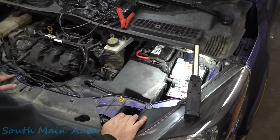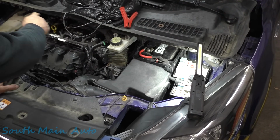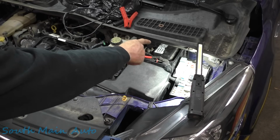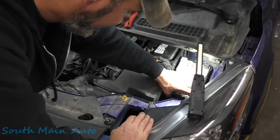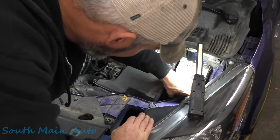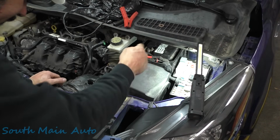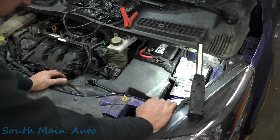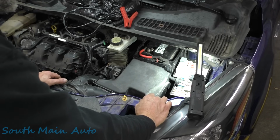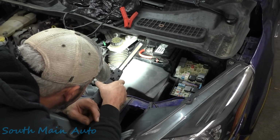So according to the wire diagram, that wire is a 100% straight shot. Runs out of that fuse box, up all the way across the firewall, over to the strut, under the battery, and then up into the bottom of the junction box. Now the fella I see has this thing already all loose. I have had experience in the past with these Fords with broken wires near, at, or under the battery box, or behind the brake booster. We've run across that too, with mouse damage and stuff.